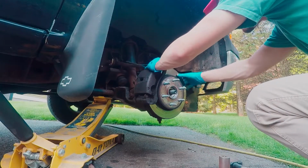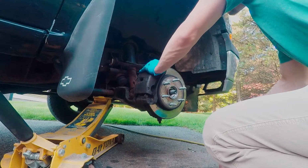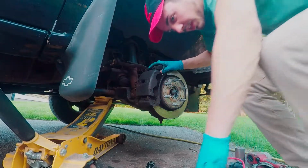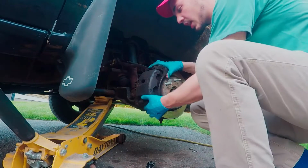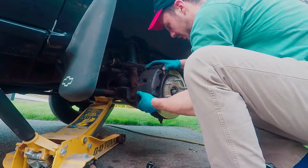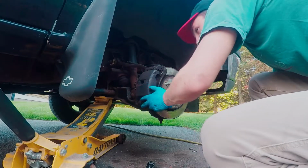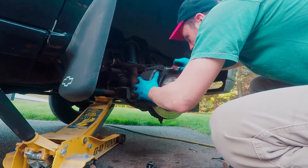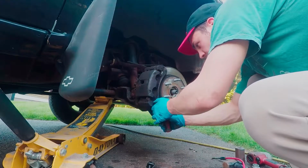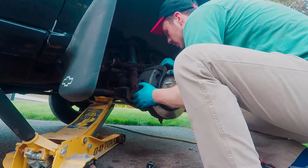Alright, now I'm going to go ahead and take apart the whole bracket system. I'll pull the whole bracket and caliper off, and then we should be able to get to the hub. So I got both of the 18s out that are in the back of the bracket. You don't have to take the caliper off of the bracket. You can just do it separately, and then to get the caliper off, sometimes you got to work it a little bit because there could be a little rust ring on the rotor, and sometimes you gotta get a screwdriver in here and just compress the piston just a little bit by prying on it, and you can get under here and just work it a little bit, and then have an easier time getting it off.